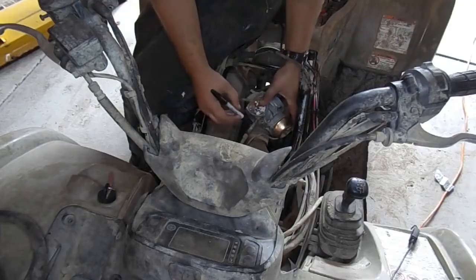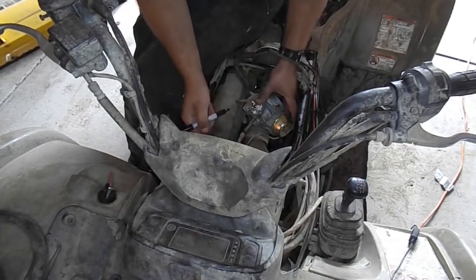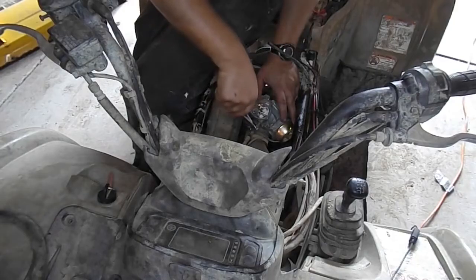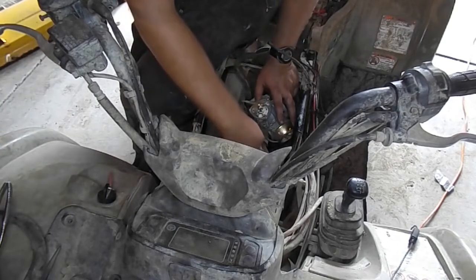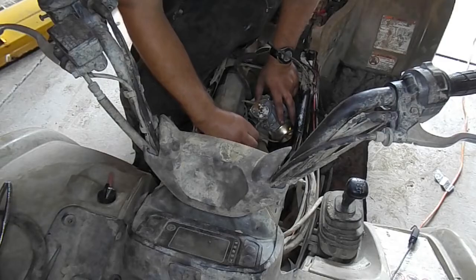After removing the cover, there is a coupling nut where the cable feeds into the carburetor. Take a marker and put a line on the coupling nut so when removing, you can count how many full turns it takes to remove it. This will be important to remember when putting the new carburetor on. Once marking the coupling nut, simply take a pair of pliers and loosen the nut. Again, when removing, do not forget to count how many full turns it takes to remove the nut.